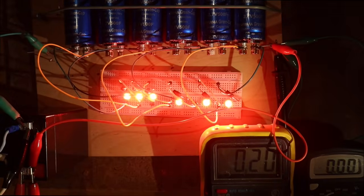More or less we did the experiment, we simulated everything that can go on in the car. The only thing is that we didn't take a very big current, because for this battery of 7 ampere hours, the current which we took of about 5 ampere would be like 50 amperes for a normal battery, which is far from the 500 ampere which the cranking motor takes for starting the engine.